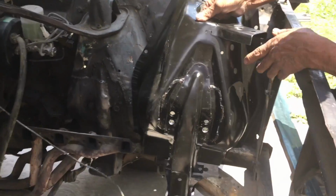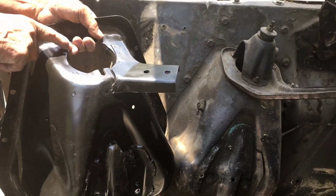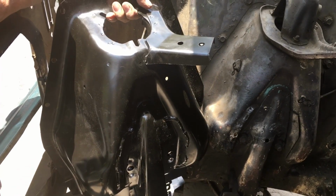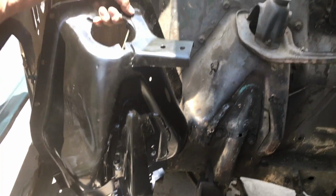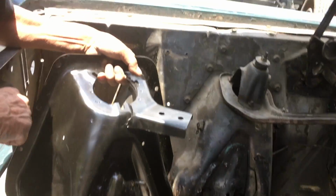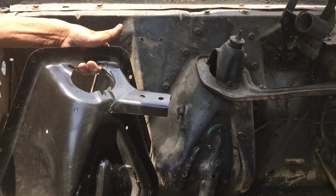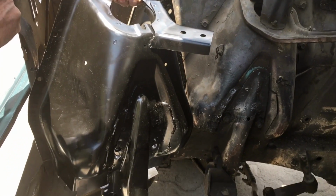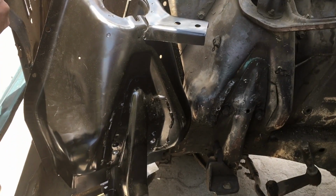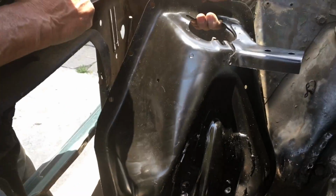Those are the new shock towers for a 65 Mustang. I have taken a few measurements on those shock towers, comparing them with the ones on the 65 Falcon. They look pretty much alike. I hope I will be able to fit them. So far, the only difference is the connection for the export braces. I have taken them to a machine shop to make the proper perforations for the upper control arm relocation. I'm gonna test this modification myself.